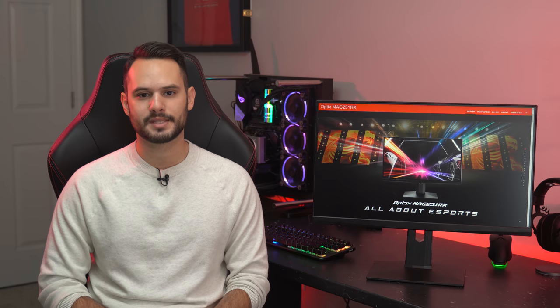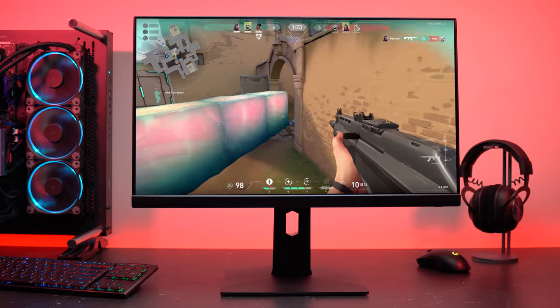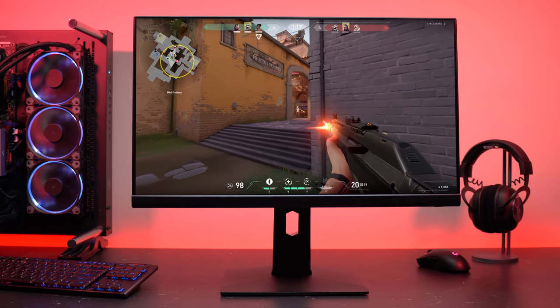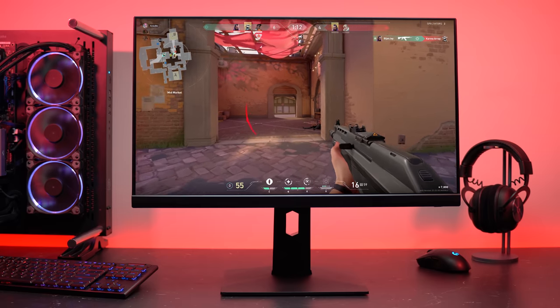However, if backlight strobing isn't an issue for you, the anti-motion blur brings the MSI's peak brightness from an impressive 437 nits down to 169 nits — a two-and-a-half times decrease. This is better on the ASUS, which goes from 415 nits down to 207 nits, and even better on the Zowie, where screen brightness doesn't get affected at all, maintaining a consistent 330-ish nits. It won't be a big deal to some, but with window shades closed and some sunlight seeping in, I had no issue seeing everything. Overall ghosting performance is great with or without ELMB.